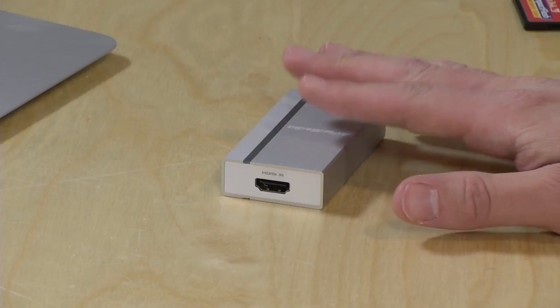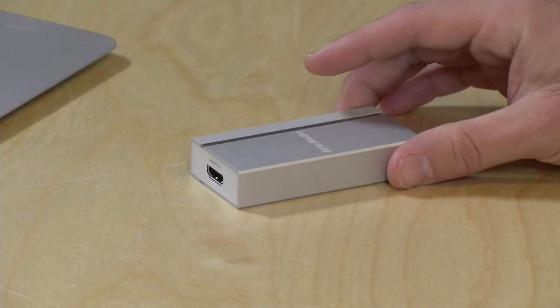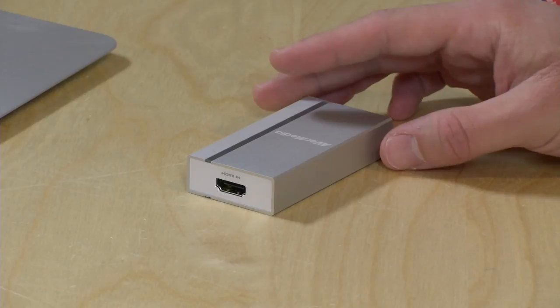They say this will deliver raw video out of the HDMI port with no compression. So if you're connecting it to a game console, it's not going to do any down-sampling or conversion to the video before it delivers it over that USB port. It's going to come over as straight digital media, which is great if you are capturing, but that does require a fairly powerful computer to get decent video at full frame rate. I plugged it into a Dell i7 from about a year and a half ago with a little NVIDIA GPU built in, and it was able to keep up with 1080p 60 capture just fine. But I'm going to strongly recommend you have a minimum of an i5 processor because I'm seeing tremendous amounts of CPU load when recording video at that frame rate.